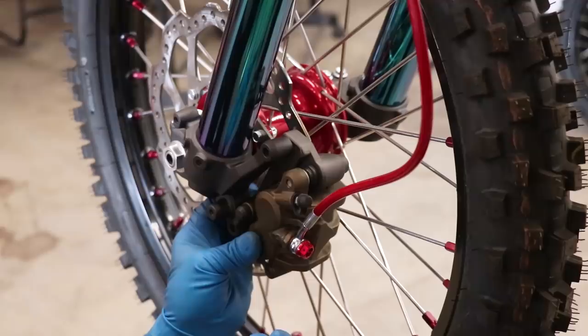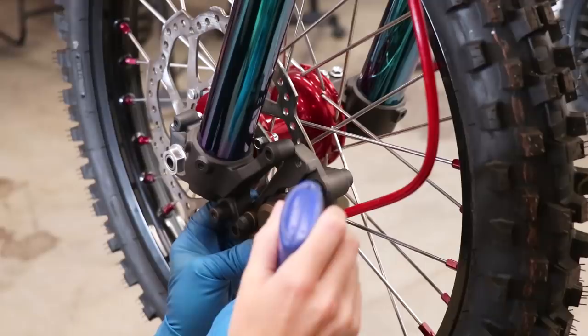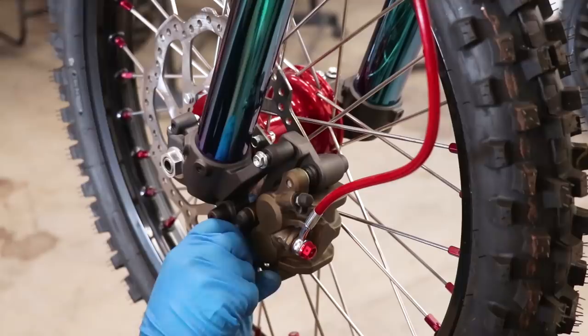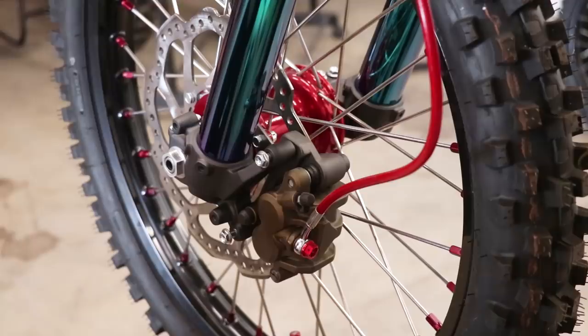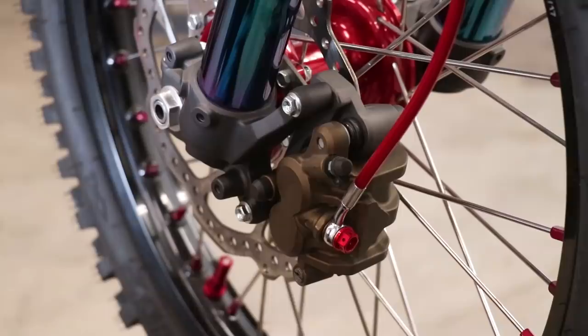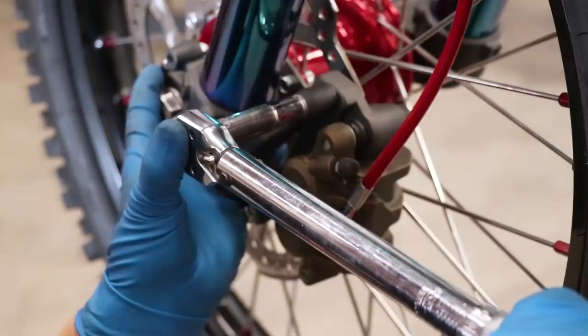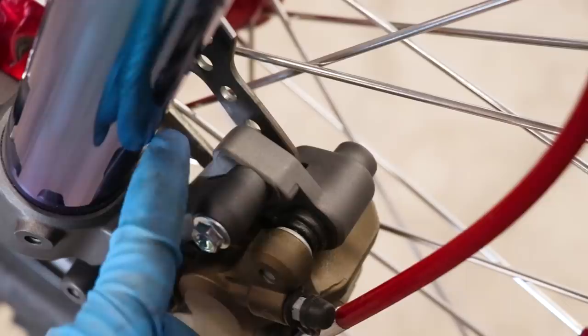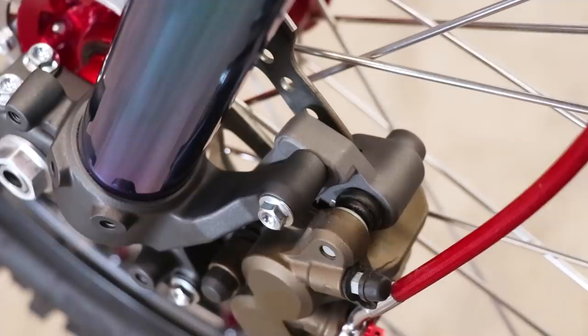Got a third hand here — Haley's here. Scored a little blue Loctite on there. It's actually nice having a third hand sometimes. The torque spec for the caliper mounting bolts is 22 foot-pounds. The only thing I didn't think about when I was picking out colors is I used a different color on the caliper mount versus the fork lug — should have gone with the same color, but honestly not too big of a deal, just nitpicking.